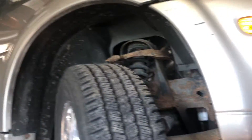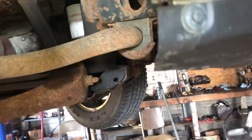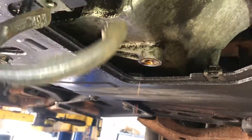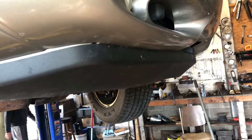2003 Oldsmobile Bravada — same as the Trailblazer. Our oil filter is right here; cut the wheel and you can get to it. You might need some oil filter jaws like this. We've got an oil pan plug right here. Take your little cover off — this one's missing it. 15 millimeter. Refill capacity on this is seven quarts of 10W-30 if it's above zero degrees Fahrenheit.